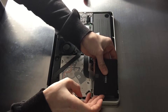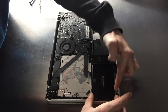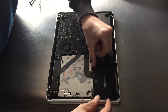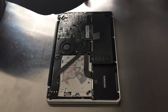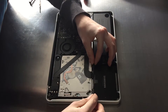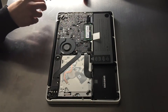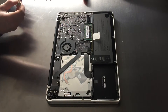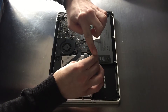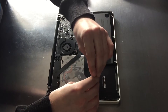Put the SSD back. You have to put those side screws in first because they go under, and then the other screws will be put in there. You can just put the bracket back on and it will keep it all in place. I do have to say I made a little mistake with the plastic pull tab — it's supposed to be on the side so it lies flat, but now it's facing upwards. I didn't bother to change it — it's not that big of a deal, it's fine.